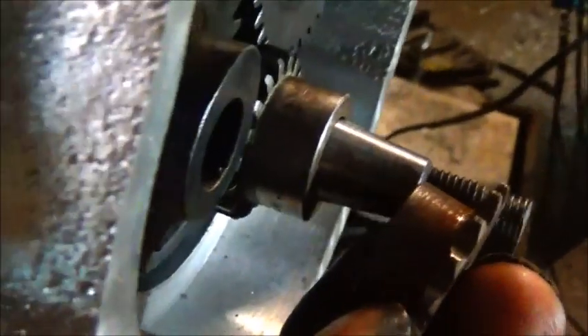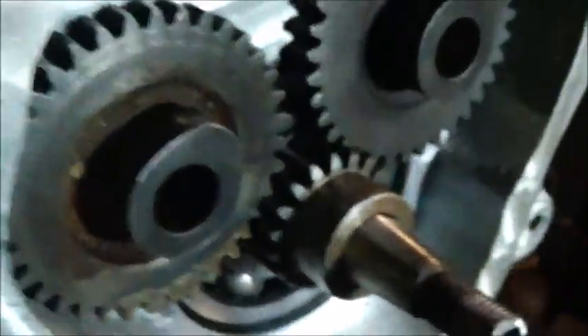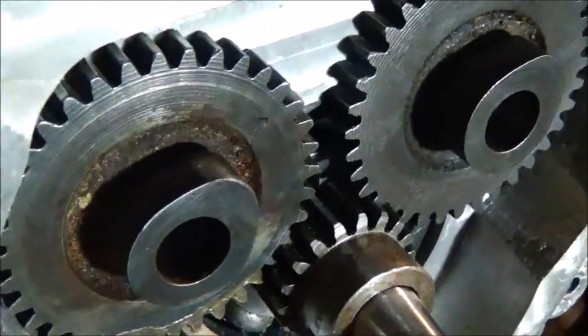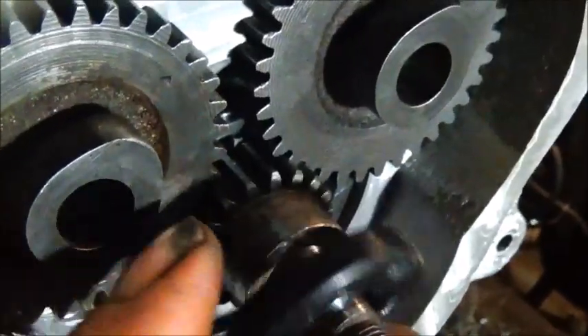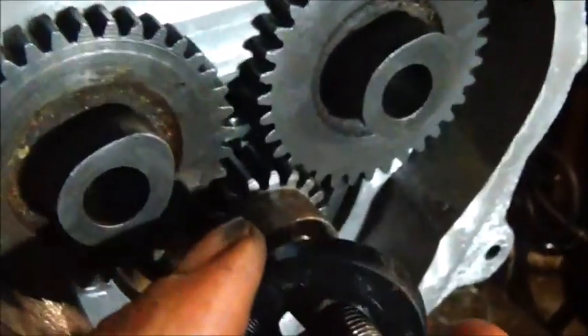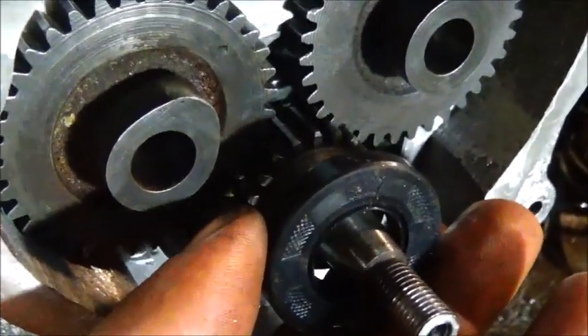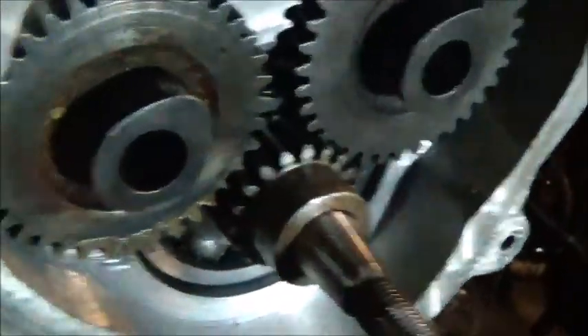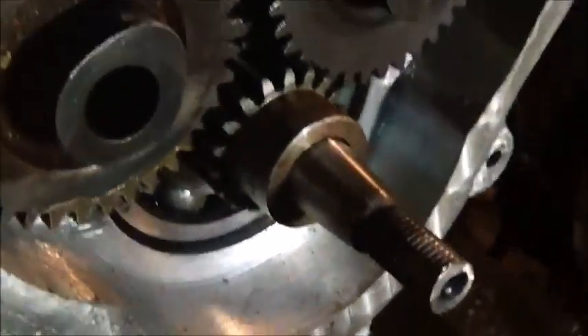That'll run everything. It's kind of hard to see on camera, but you can see that the surface of this is about even with the surface of this. When I make my cover, I can protrude out or machine inside of it - that's not going to be an issue at all. We'll use the original seal - this is the outer seal for the Yamaha 250. When I bought the bearings for the crankshaft, I just bought a kit that came with both seals. We're going to get by using those seals and it'll be no problem to find replacements. I want new-style seals on it, I don't want leaks.